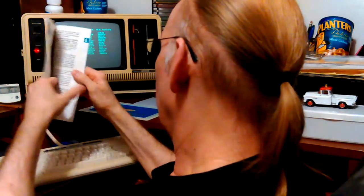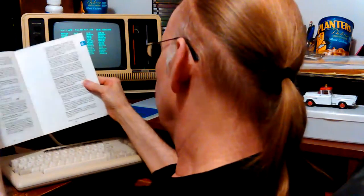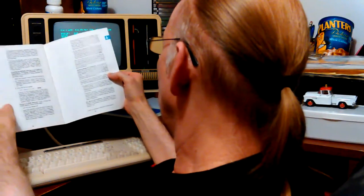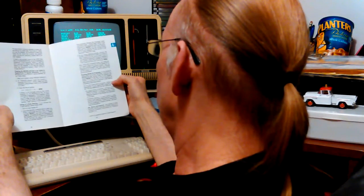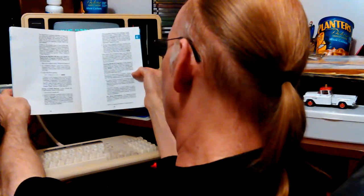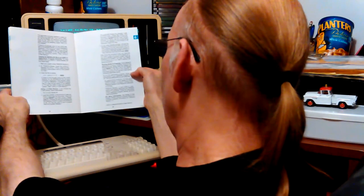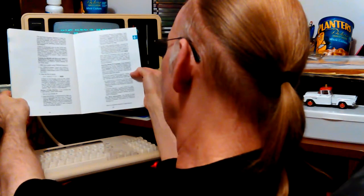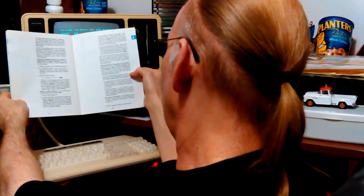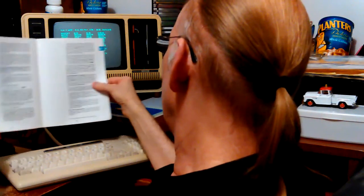It's really a pretty good, quick, and concise instruction manual. Using a two-disk startup, there we go. Turn on the Model 4P, insert the Model 3 boot disk into the drive, press reset, and then press a lowercase p. Pressing p tells the hardware that the diskette in drive 0 contains Model 3 files, but that you want to use a program that is on the disk.